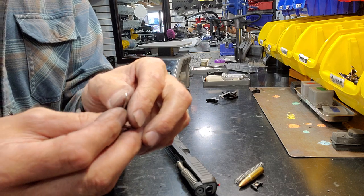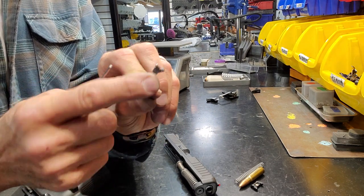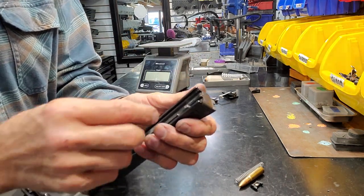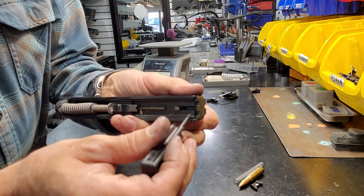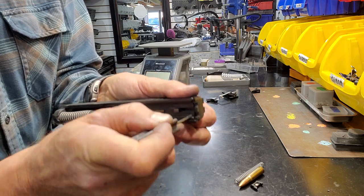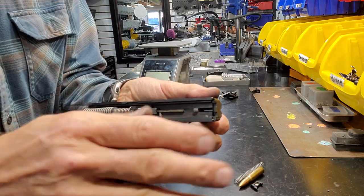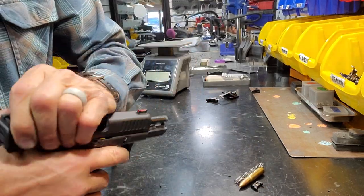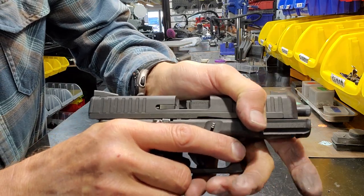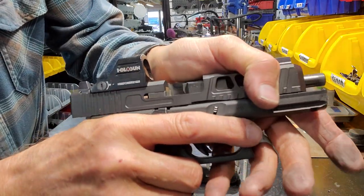It's deduction, you know what I mean? So I'm thinking, okay, if I bend this back a little bit toward the housing, I'm not going to have as much pressure pushing out on this outcropping. If I don't have as much from the spring steel of the connector pushing out on this, it's not going to be as abrupt. You're not going to have that abruptness right there. And so you can see right here, you can't even hear it.